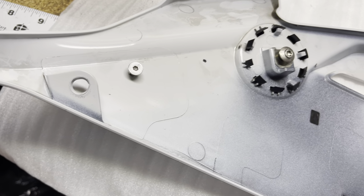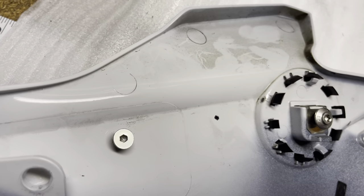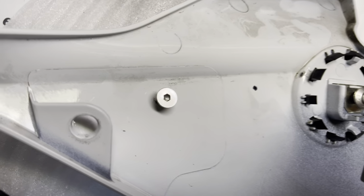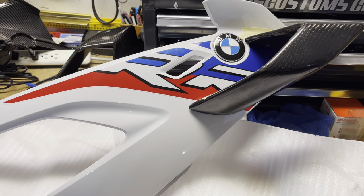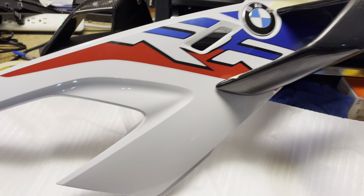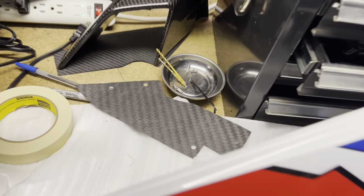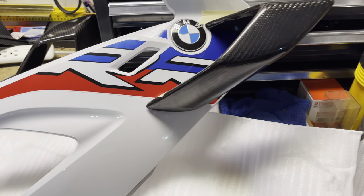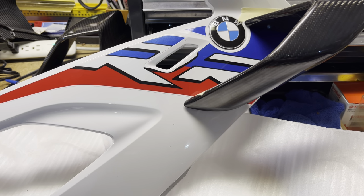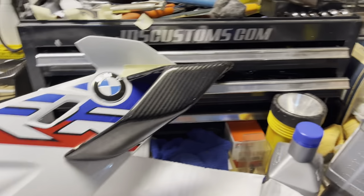That's so nerve-wracking. The drill bit that I ended up using is a 3/16. Let me double check on that and I'll get back to you in a second. All right, I did confirm it was a 3/16 drill bit. I went a smaller size, a size up, and then I ended up with 3/16. Obviously, you want to check your bolts for whatever type of wings you have because it may not be the same as for this brand that I got. But this is basically how it's going to look for the most part.